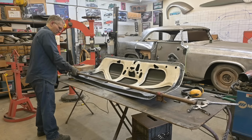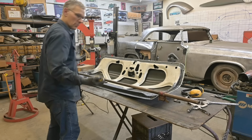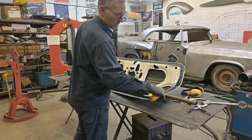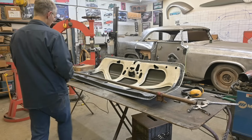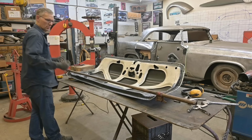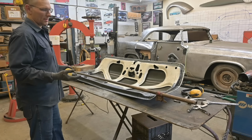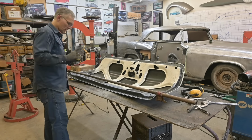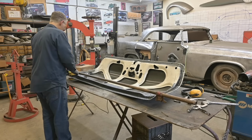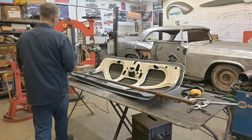So I'm gonna give it a little more of a squeeze, because I've talked about a thing called spring back. That's where you squeeze it and then it just bounces back to where it was. We're sitting at 62 3/4. Sometimes you can't just start tearing the car down to absolute nothing. You'd have to take the quarters off. Didn't want to go into that. So we left the quarters on, massaged the body panels, worked around it, and we were able to get that car looking really sweet. 62.5. Let's give it a try.